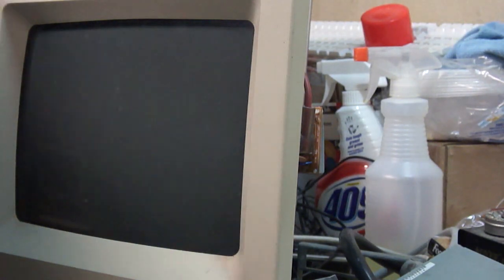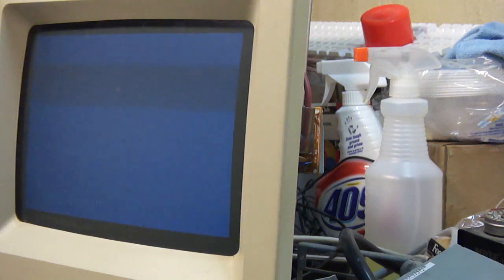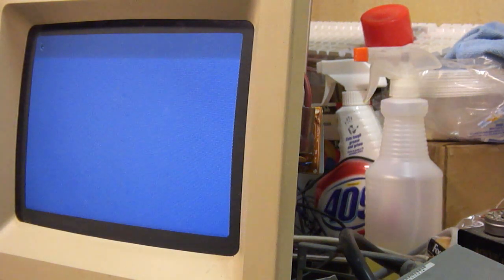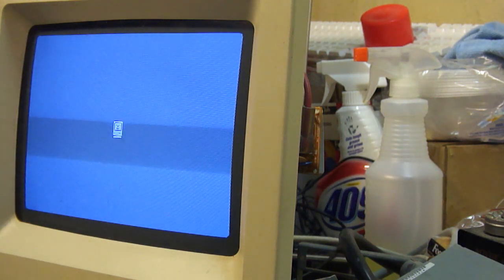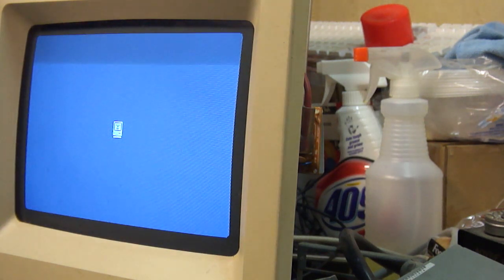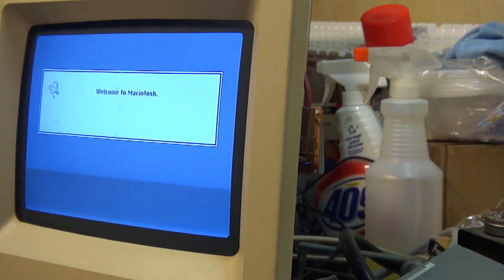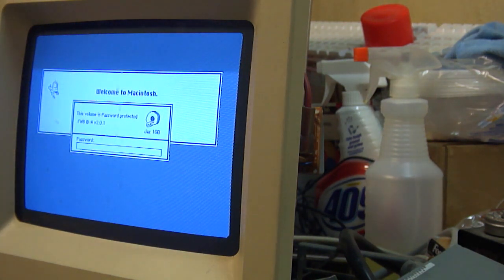Howdy everybody in YouTube. Let's try again using a manual inject drive instead of my one that's in there, because I honestly think the drive needs demagnetized. It's not damaging the discs physically, it's damaging them magnetically. Meaning I have to initialize and reformat them before you will read again. So that's why I'm thinking the actual drive heads become magnetized over the years.